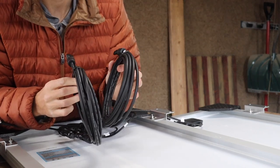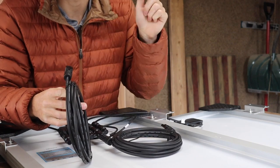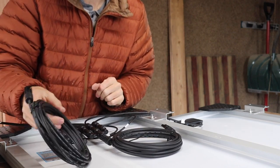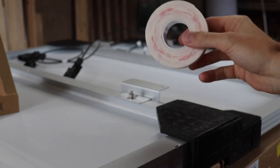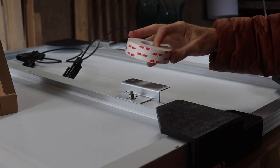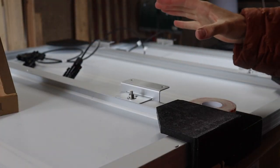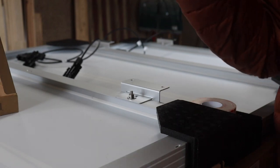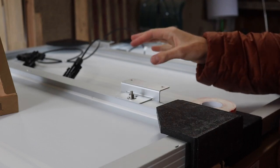These 15-foot cables are what's going to run through the top of the van and down inside to connect to the Goal Zero. Before climbing up on the roof and installing these, I'm going to cut all of my VHB tape onto each and every one of these brackets on all four sides. That way, when I get onto the roof, I can just peel the tape off, stick it right into place, and we'll be good to go.